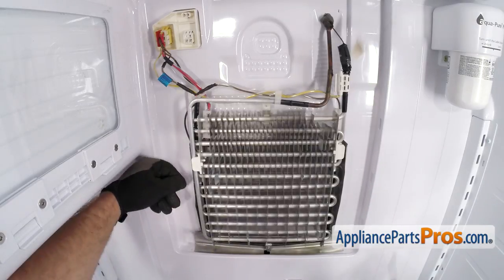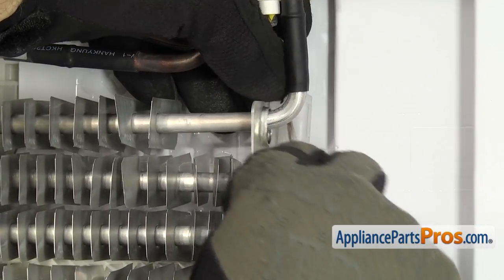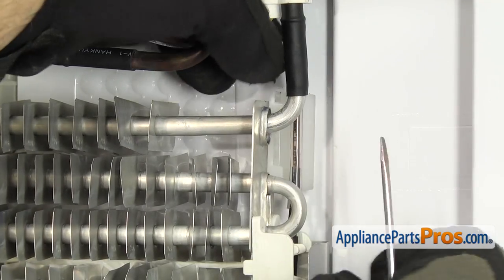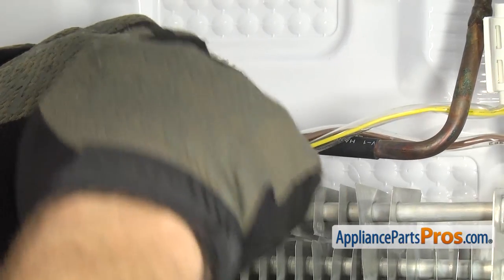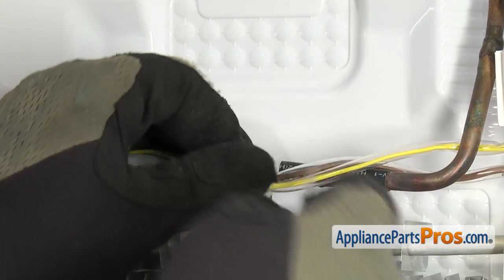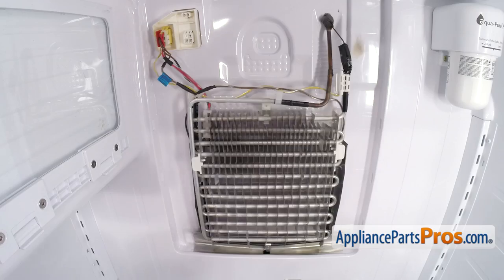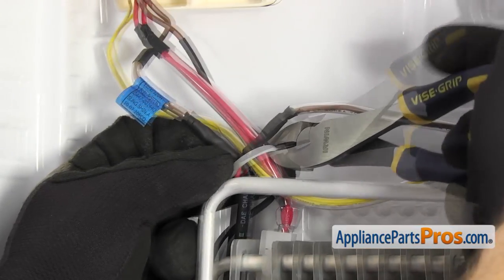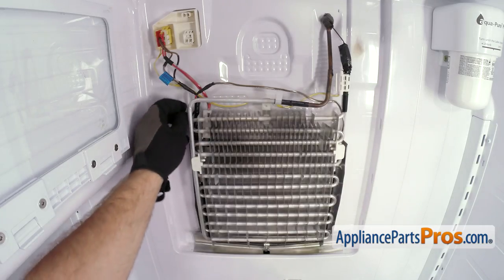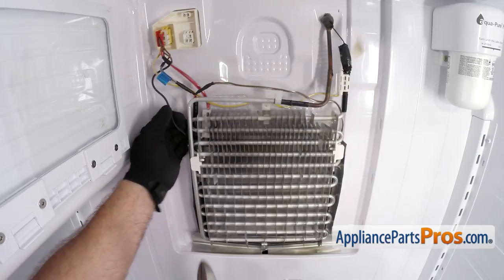Once you figure out what style you have, we're going to reach in and open up the holder on the right-hand side. There are a couple of locking tabs — we're just going to use a small flathead screwdriver to release them. Once you have it open, you can get the wire out. Then we're going to follow the wire up to the holder in the middle and pop it free with a small flathead screwdriver. Once you have it open, take the wires out and get them free. Then follow the wire over and cut off the zip tie that holds all the wires together using wire cutters. Once the zip tie is off, we can find the other heater wire and cut both wires.